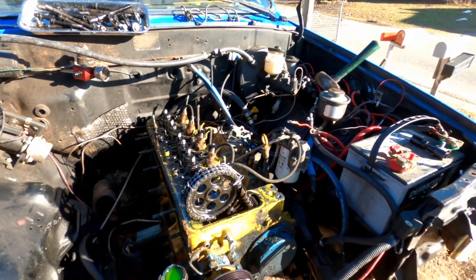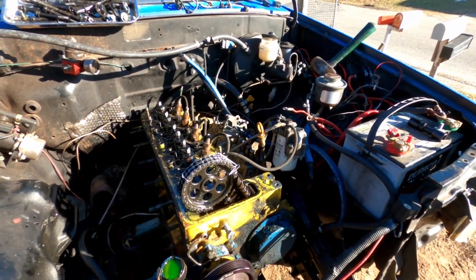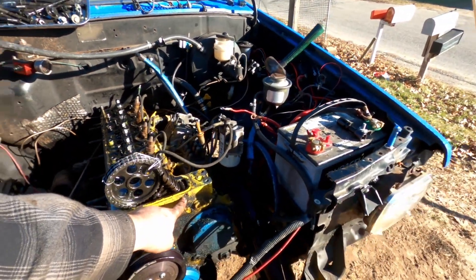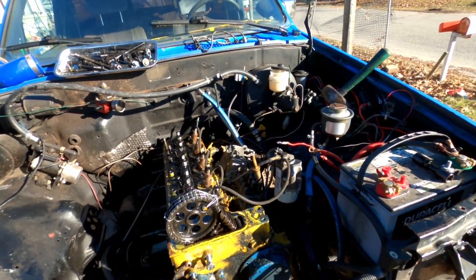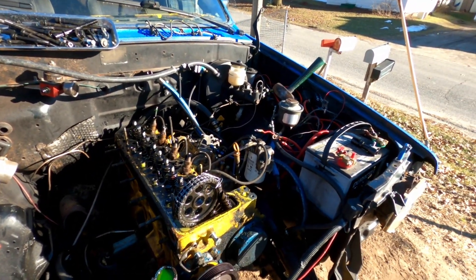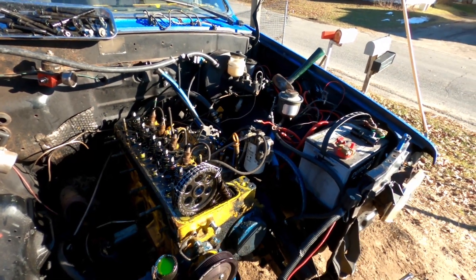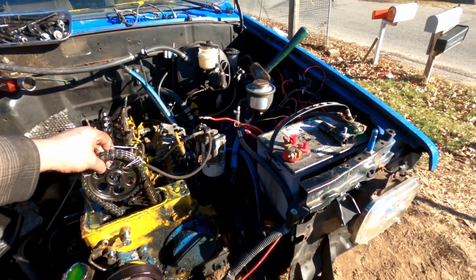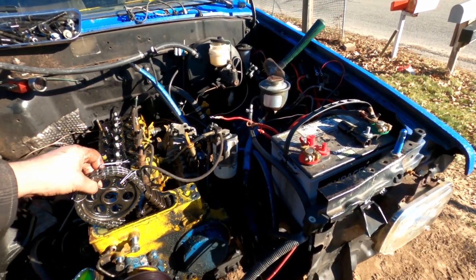With the cam off and everything else, this is kind of what you're left with. You can see why I had to tie this up — there's a pin in here and I think it's threaded. I remember using a bolt welded to a slide hammer to pull that out, and I think I need to do that in order to be able to lift the head off.